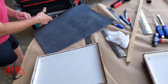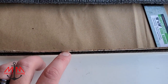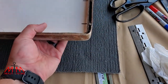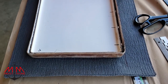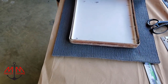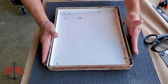I get lots of calls about putting the carpet on these lids because there is a little channel. The first thing we did is remove all the rivets. What I did is make sure I had one really good square straight edge, folded it over, and made sure I had enough carpet to leave some trim room. Two and a half inches is perfect for this lid — it gives enough to tuck inside the channels.